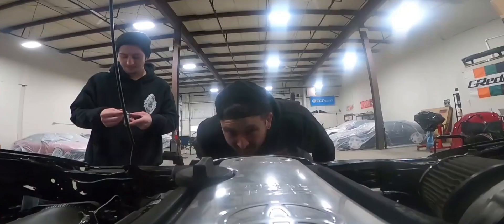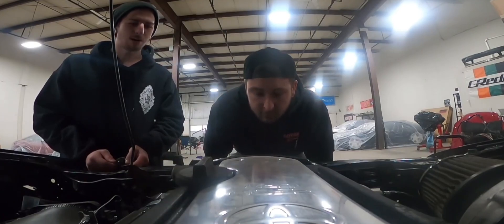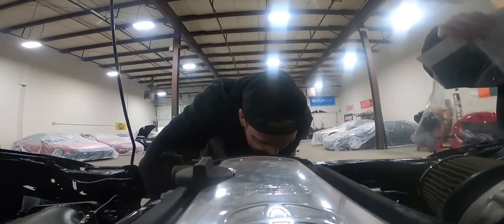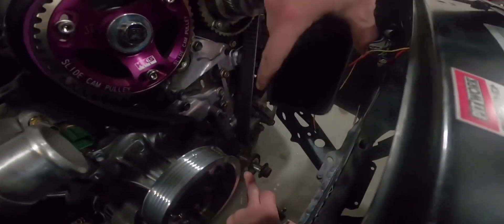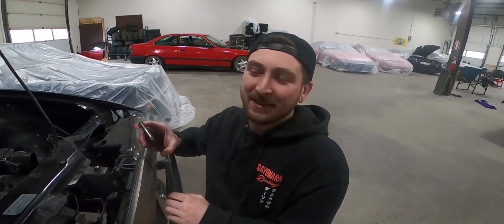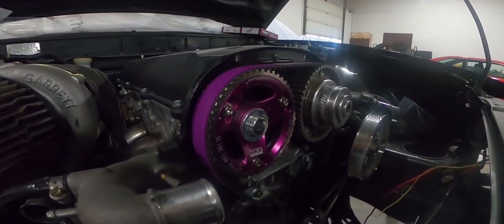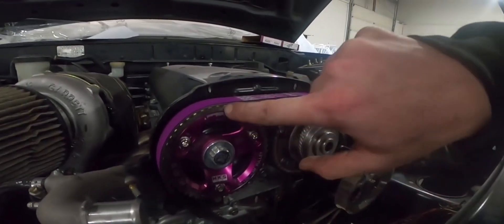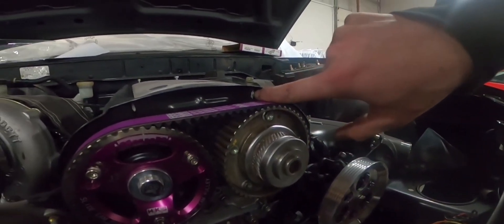I can't wait, it took so long, so unnecessary. To make your life easier - take the old belt, mark the old belt, then mark the new belt. The weird thing is when you time them it always wants to go slightly next to the mark, and everyone wants to go right on it - it drives everyone nuts when they time a 1J. So what you have to do is make sure these two cams line up with these two dots right here, because there's two slits - one there, one there.